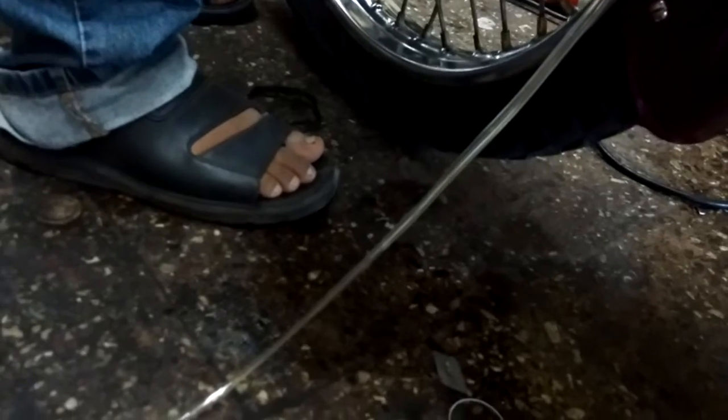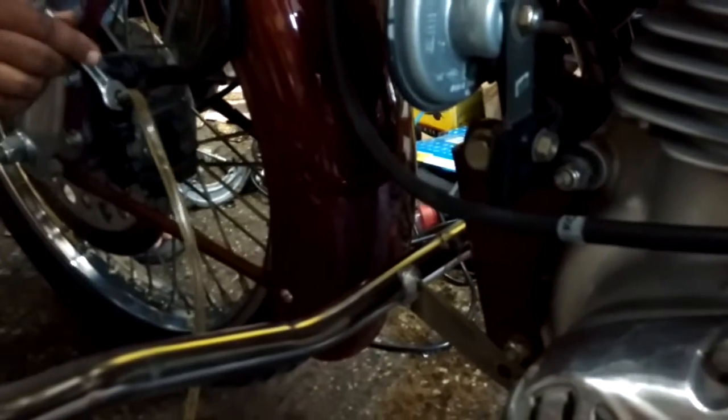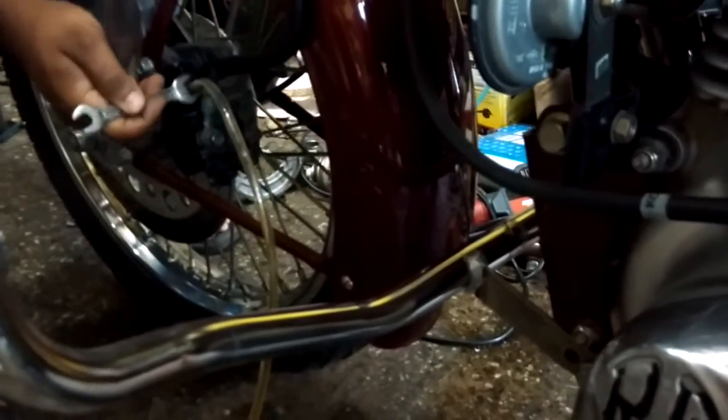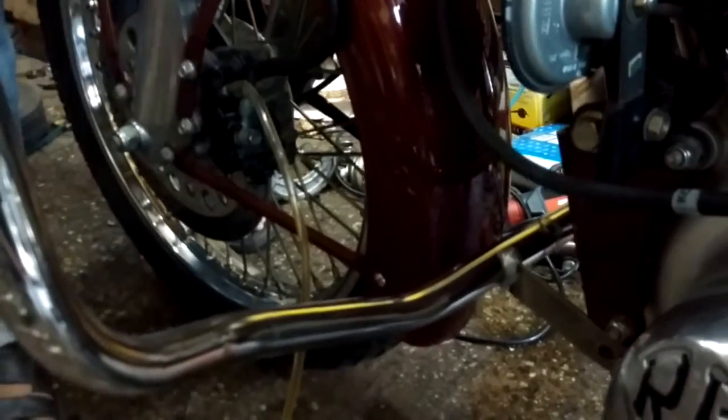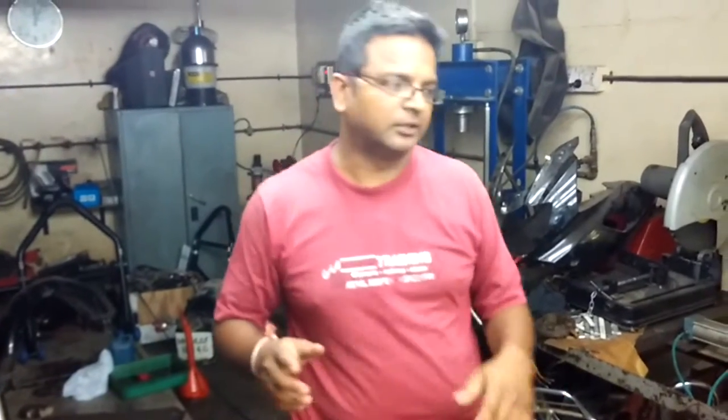As you can see, the fluid has started to move. I am not raising the RPM since the vacuum is too much — I don't need it this much. That's it. Some people try to suck the air out with their mouth or something, but don't forget it's a chemical — it has got some acid content inside, so you might hurt your own body. Don't do that.